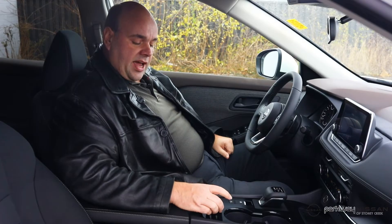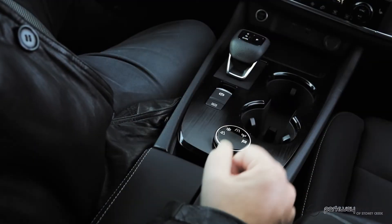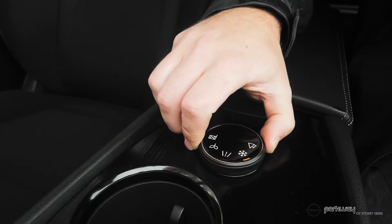If I go to the other side of this dial, it's more to do with weather and road conditions. I have a snow mode for this car. What that does is — this car would normally turn into front-wheel drive a lot of the time in order to try and save fuel, but in snow mode it will not do that. This car will be in four-wheel drive all of the time to some extent.